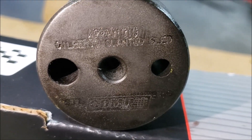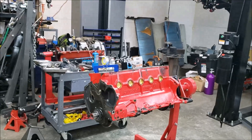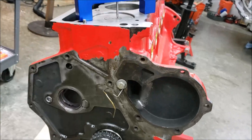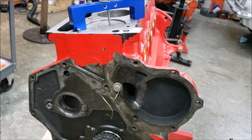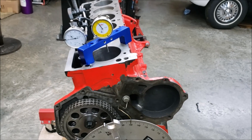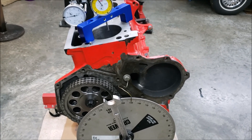That's a pretty custom cam, just for Mr. Gilbert's slanted sled. We're gonna get ready to put that in today, getting it all set up to degree this camshaft and start getting this thing together. Hopefully I got four days off - I want to make it running. Moving on: we just degreed the cam, it's a really simple deal. I do the intake centerline method. This cam is on a 110 degree lobe separation angle, so I'm gonna put it on 106.